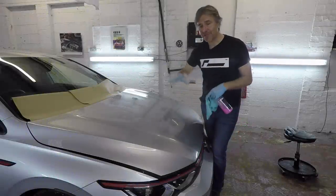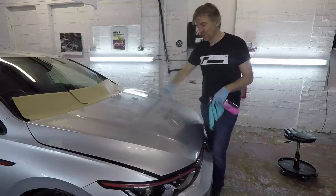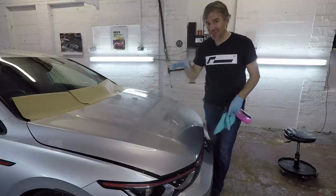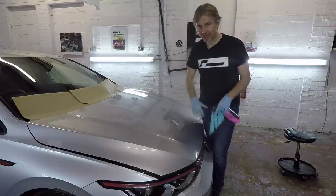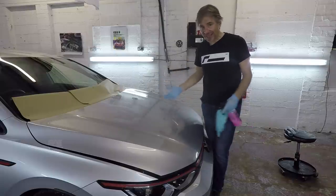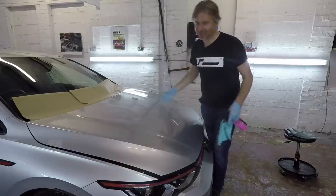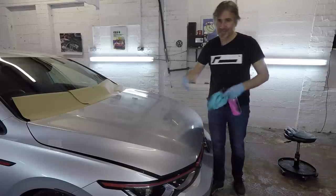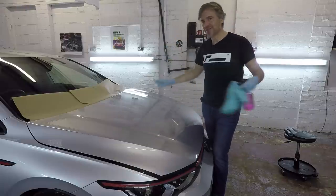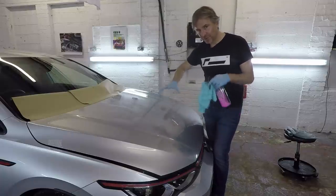There's no point showing you the polishing process on every panel of the car — we're going to concentrate just on the bonnet. As I said earlier, the paintwork is in really good condition. If it wasn't, you'd need to use a more abrasive compound to get rid of swirl marks and scratches, and then bring the shine back with finer compounds. I don't think I'm going to gain an awful lot by polishing this even with a fine compound, but I just want the paintwork to be perfect before I apply the wax — things like bug stains on the front of the bonnet are just easier to get off with that.